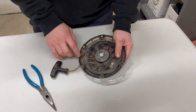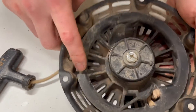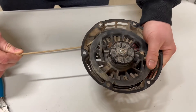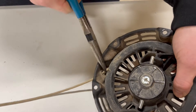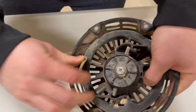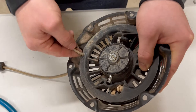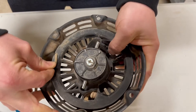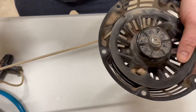So what we'll do, we'll flip it over. You need to locate the cutout in the housing here, right there. What you want to do is line that up with the actual hole in the recoil where the rope feeds through. You can do that by just pulling it as if you're pulling the engine over until it lines up and stop it right there. Then you take your needle nose pliers, pull the rope through, and you need to put it in that cutout. That's what that should look like. Then give yourself a little more rope and grab the one that's through the cutout and just go counterclockwise with it one turn until it lines up again. Then all you have to do from there is pull it through and let it go.